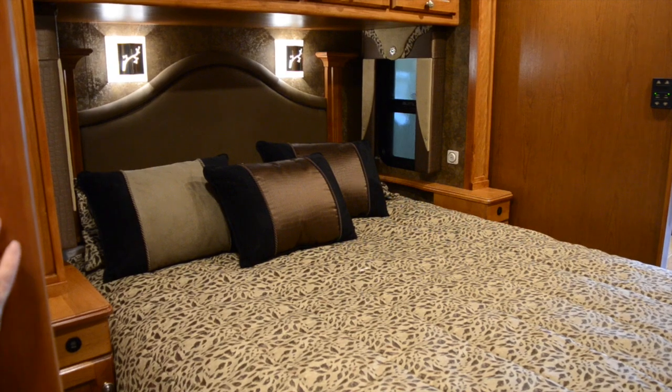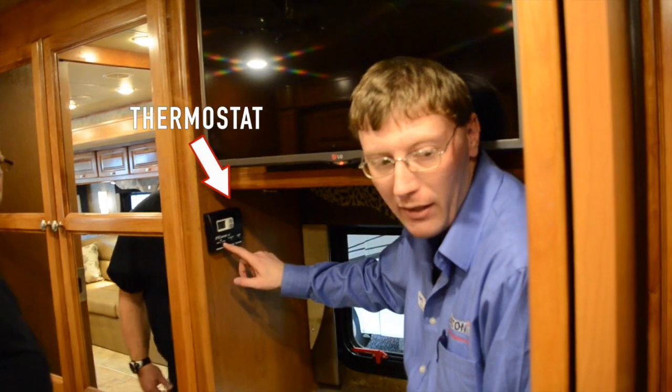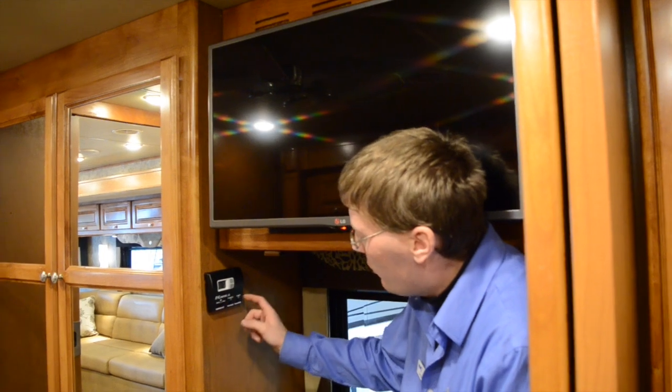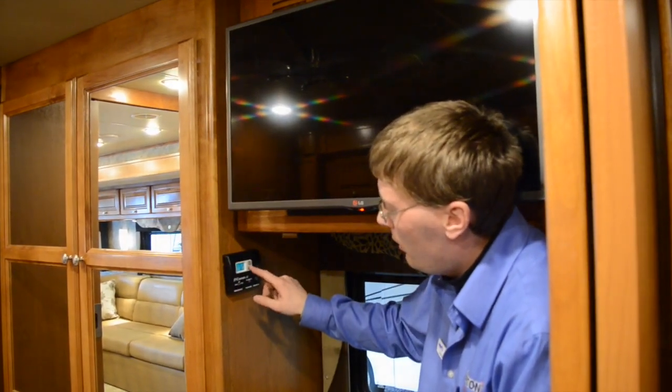Okay. Your thermostat over here, RV Comfort, just choose what you want to do, okay? Because you guys only had one furnace outside. Heat's not going to exist back here for you, but they don't make a thermostat that says cool only. So, you're just going to leave this on auto, over to cool, and then...